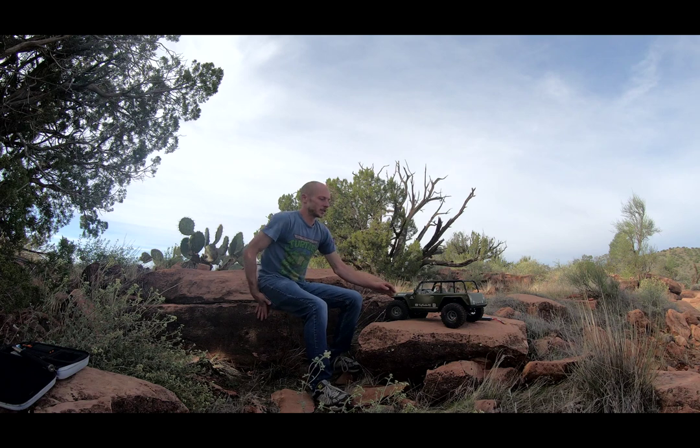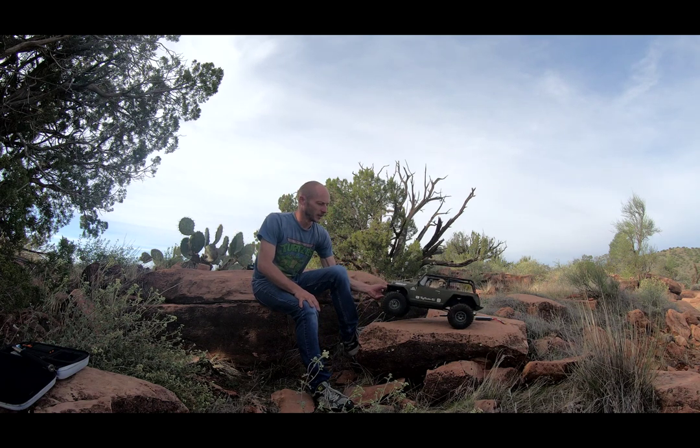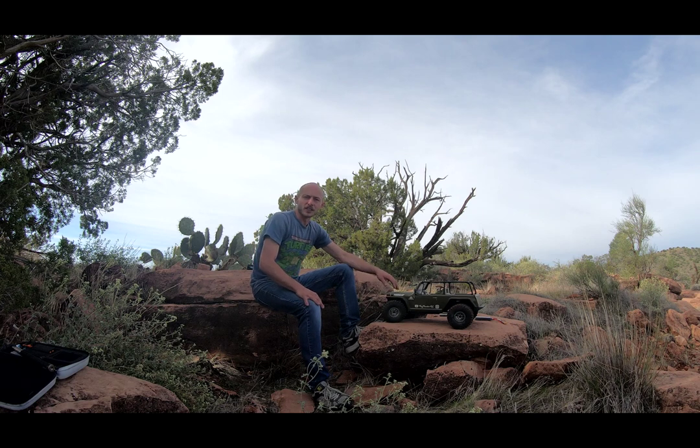I started with a Wendigo sway bar kit and used that mounting bracket after being drilled out a little bit to fit the 5mm sway bar for the SMT10 that it came off of. It definitely firmed things up a bit. It keeps the rear end tucked and low when articulating, and it really helps out.